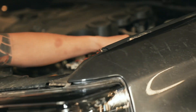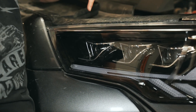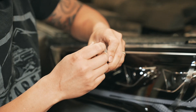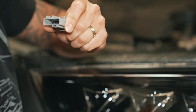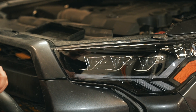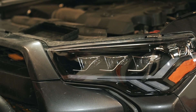So when you guys install these and you've got everything plugged in and you turn the lights on and you see flickering on that high beam slash DRL inner bulb, just remember to pull this gray relay out and flatten the second pin from the right — the one away from the big pin on the left — and that will fix your issue. That's the only thing that's different when installing these GTR lighting headlights. Other than that, everything is pretty plug and play and similar to all the other headlights.